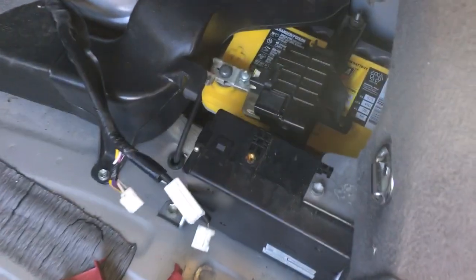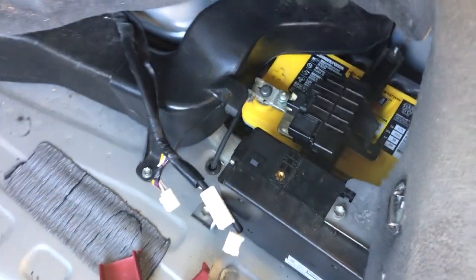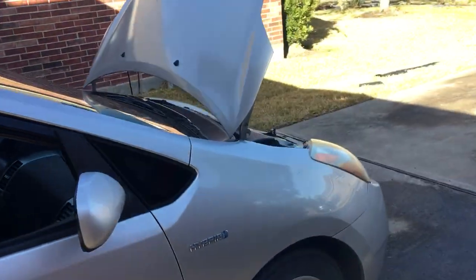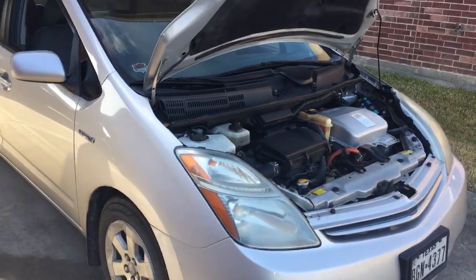To do a recap: if you've replaced your pump, go over here and disconnect your 12-volt battery, let it stay disconnected for about five minutes, then reconnect and you're back in business. I hope this helps everyone out there. Thank you very much and have fun driving, bye bye.